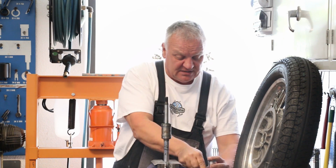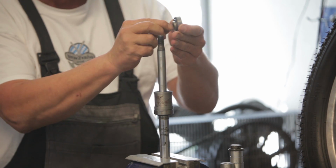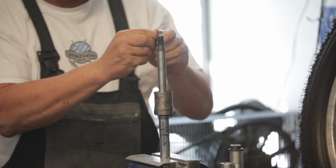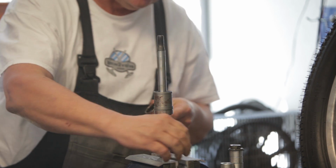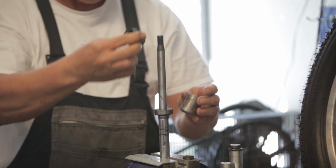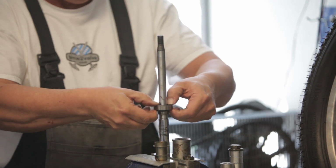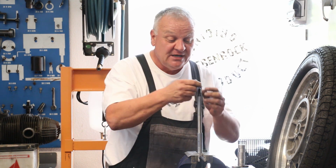These are my spacers. And this is the, oh man, I think it's stuck. There's a shim. Taking these parts off and the bearings off. I've chucked the axle in the vise here, and now I'm going to put all the wheel bearing components on there to check for the preload.